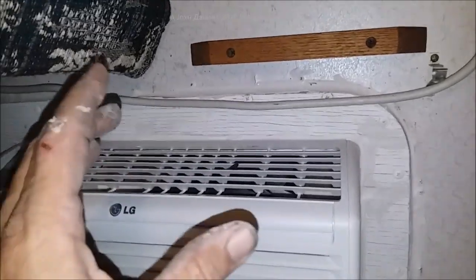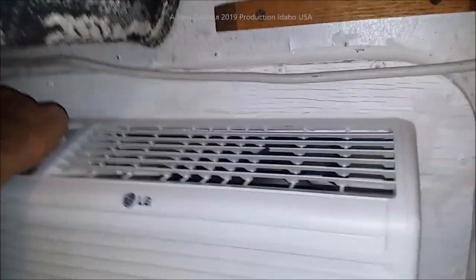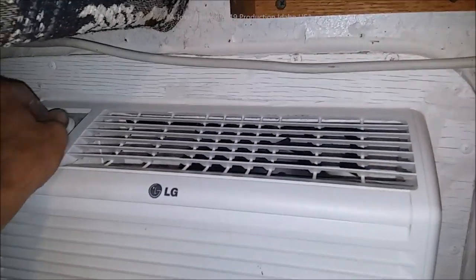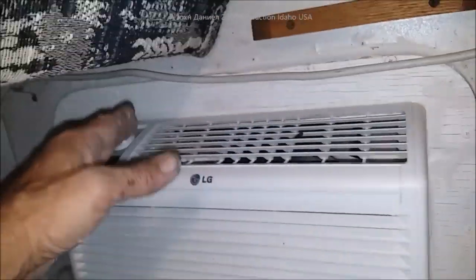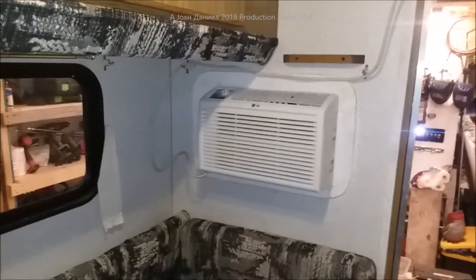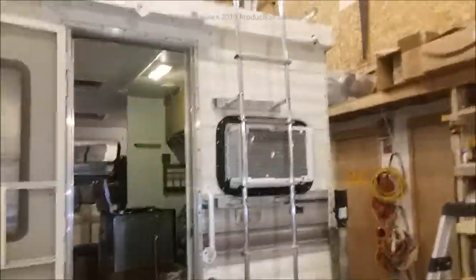Being that it pulls only 425 watts max, I've been noticing it's only pulling about 350 watts — but it's 425 under a heavy heat load. Let's turn it on. Hear that? There we go — nice cool air, just right. You can't feel air here but you can start to feel it right there. Those vent directors keep the air going in the right direction, sending it up into the front. Not bad — just need a little re-routing of the cord, but there we go. You can do this!